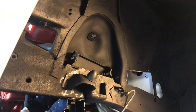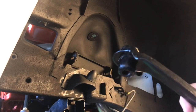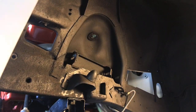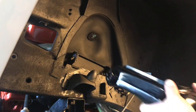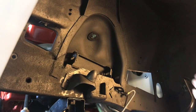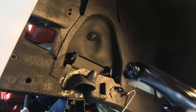We're going to put the upper control arms in. I've already got the upper bushings pressed in as you saw earlier. I'm not going to put the ball joint in yet because it's better to use the car as your vise to hold the control arm while you're sitting there turning the ball joint in.